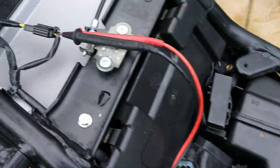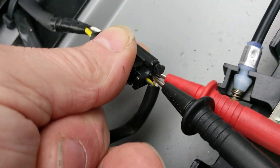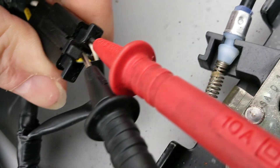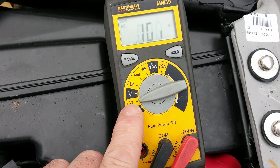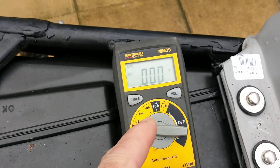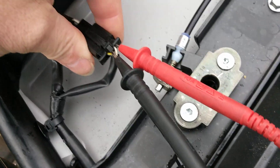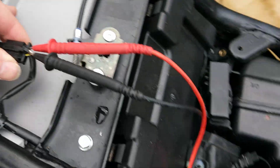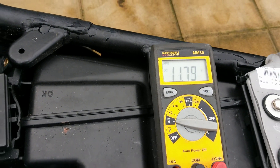I've just done a little bit of exploratory work with the electrics to see what's what with the power. I've got my multimeter there, and here is the plug which feeds the rear light. You've got a yellow with a grey trace on the left, black in the middle, and white with a yellow trace on the right. The center black is neutral, or earth, or common. Set your multimeter to DC - we've got nothing flowing at the moment. Turn the key - nothing there with my black probe in the earth and the live probe in the white with the yellow trace. Put foot on brake - gives us 12 volts. Off, on, gives us 12 volts.